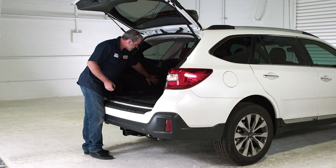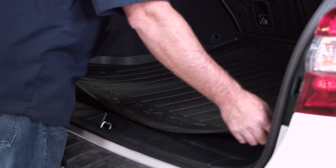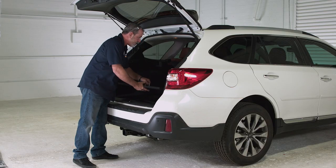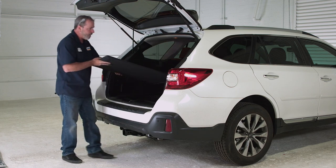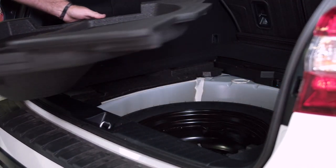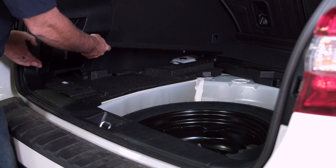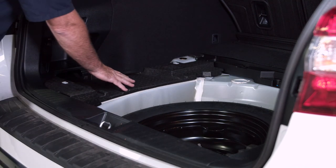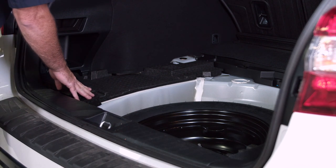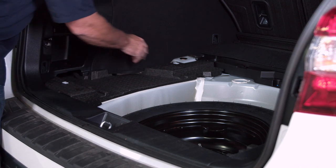To get to this, we're going to need to take out the flooring. We've got the centerpiece and we're going to remove the storage jack compartment. Then we're going to remove the driver's side flooring — that just pops right up. We've got one last piece: the foam padding for the driver's side flooring. I'm going to use a trim tool to take off a couple of plastic pieces.